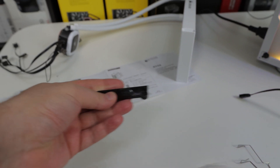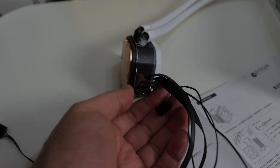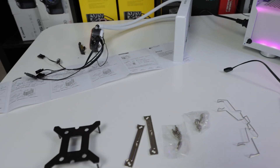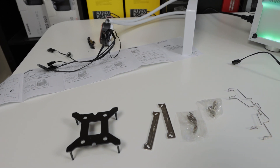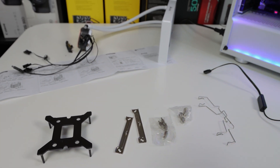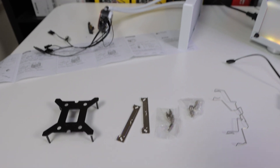The clip-on process for AMD: you basically clip the cooler's retention bracket onto the plastic AMD backplate clips. Corsair does this the best — no need to remove any backplate. I wish more AIO and air cooler manufacturers went that route for AMD. This process isn't super hard, but holding the backplate while screwing it in is a bit of a pain.